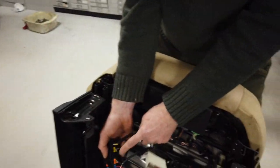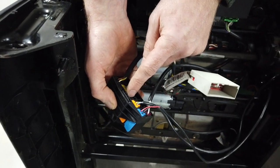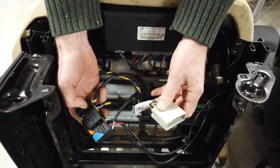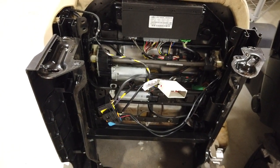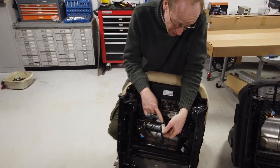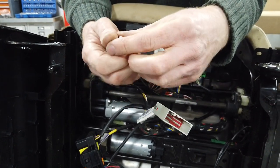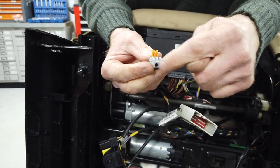So even with no motors, you still have the seat belt and airbag functionality. Jumping over to the electric seat, these four connectors here are all seat belt and airbag functionality, and these ones are for the heated seat. So we are going to snip these wires, join them in the car and see if it works. What we're going to use to join them together are these little Wago connectors - I love these things.